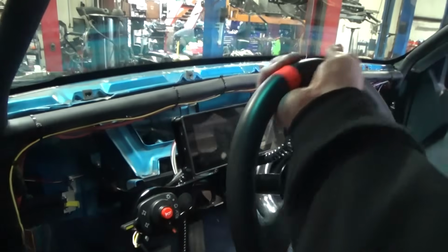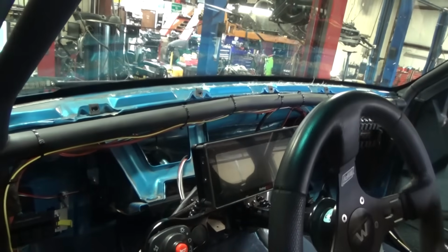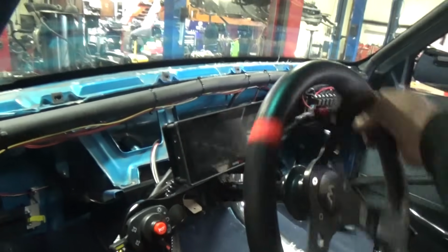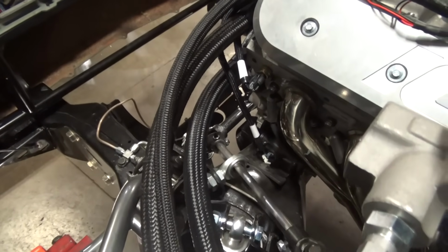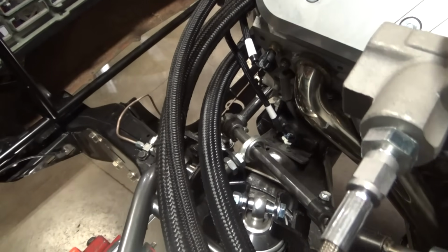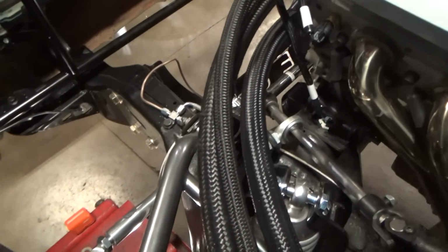The steering, when you roll it over, it gets to a bind, and then it rolls through, which is kind of weird. It's probably the universal joint down there binding. Definitely that universal joint binding. So I'm going to shave it a little bit.